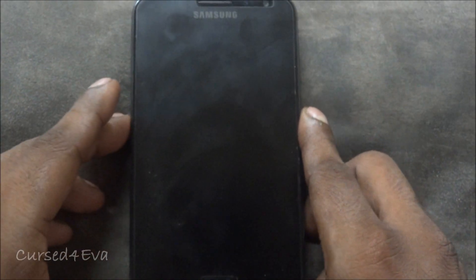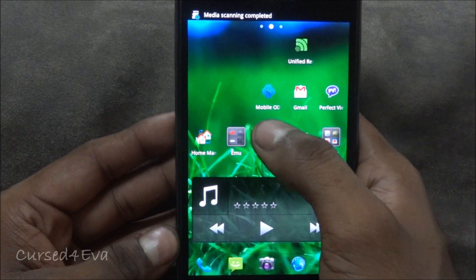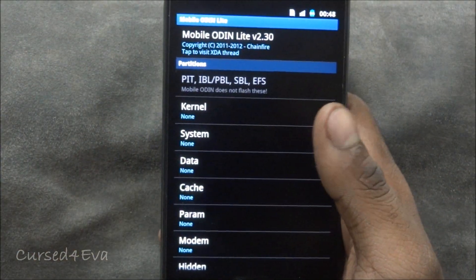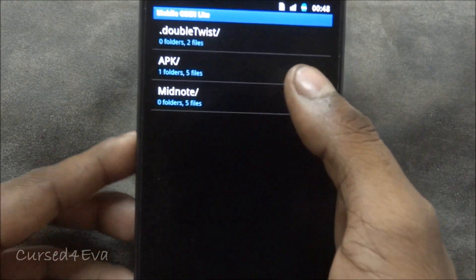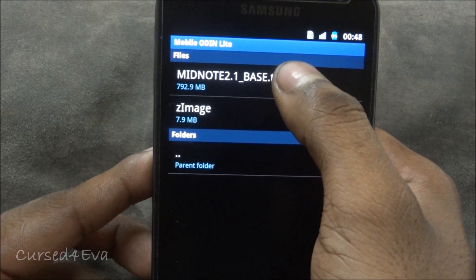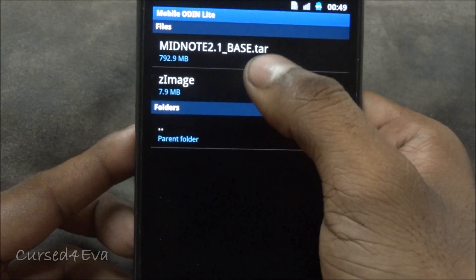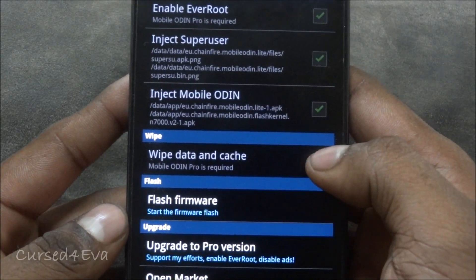This will take a few seconds. Once that's done and you see 'Install from SD card complete,' go back and hit 'Reboot system now.' Once we are up, go to Google Play and download Mobile Odin — or you can get the light version for free from XDA Forums. Scroll down, tap 'Open file,' navigate to the external SD card, go into MidNote, and select 'midnote_2.1_base.tar.' I know it says 2.1 but that's the right file. Then go into Kernel, tap 'Kernel external SD.'